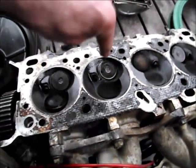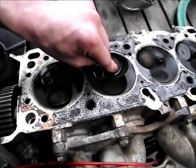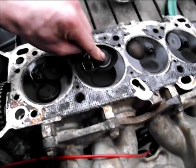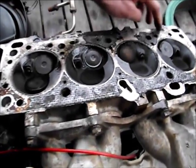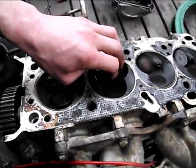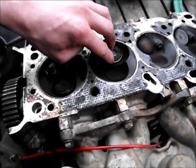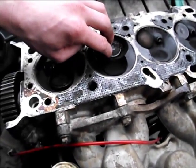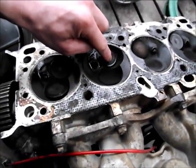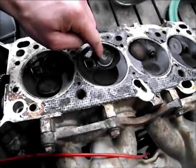So the lesson here is: if you do not have hydraulic tappets — lifters, whatever you want to call them — you need to adjust your valve clearances. I recommend every second oil change, every 20,000 Ks, adjust your clearances as per the manufacturer's instructions. You don't necessarily need to do it in a specific order with an overhead cam, but you do need to do it on base circle — that means with the cam lobes in their lowest downward position, away from the rocker arms. It's got to be all the way on base circle.